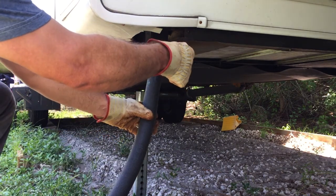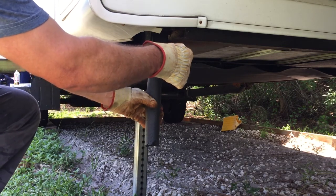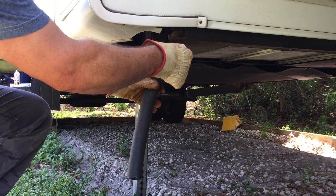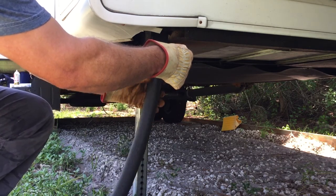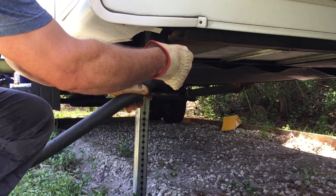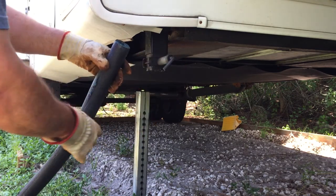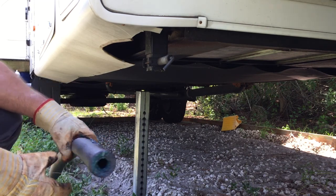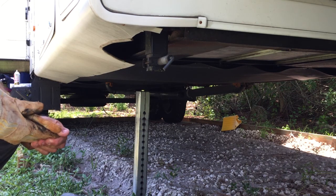This is our third time — I'm going to pull the pin, send it up, get some more grease on the very edge, put it all the way up in there, give it a good turn, and start pulling it out. I've seen several different ways of doing this: some people go to the hardware store and buy a one-inch piece of plastic hose and rig it up with a fitting and a zerk fitting — probably costs $25 or $30. I've also seen people take a piece of PVC pipe, cut it in half, and spin it around the screw. Those are probably all fine ideas. This foam insulation was pretty cheap — I actually found it in the trash — so all I've got invested is the grease and some time.